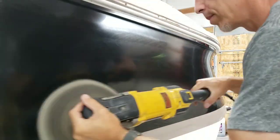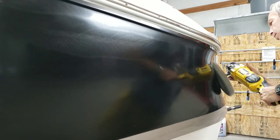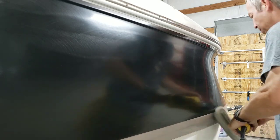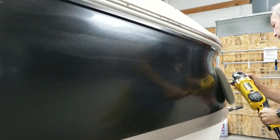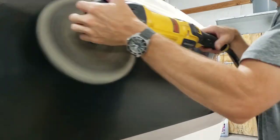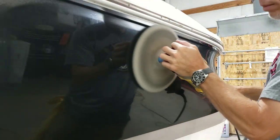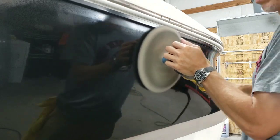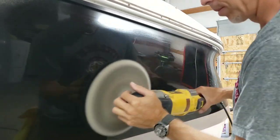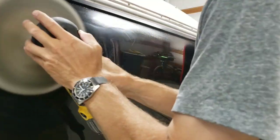In other words, if you focused on the entire piece as one section, and you were working the middle, and you touch the top, and you touch the bottom, and you touch the top, and you work the middle, you're fighting a lot of potential for swirl everywhere. Every time you touch the top and that pad changes its geometry, you're causing a swirl. Every time you roll off that bottom edge at speed, that buffer wheel changes its geometry, so you're risking a swirl. Whereas if you hit your edges really aggressively and get a nice gloss, then hit your middles, you alleviate about 95% of the chance to leave a swirl because you're just going flat. And if you're going flat, you generally don't leave a swirl. That's not a promise, it's just generally.